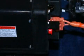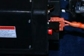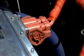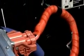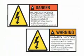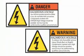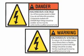Hybrid vehicles contain high voltage batteries and components, so safety is of the utmost importance. Eaton has designed its hybrid vehicles with safety first. High voltage cables are clearly identified with bright orange casing and contain high voltage warning labels. Never cut or open high voltage cables or components. Also, never drive the hybrid vehicle through deep standing water.